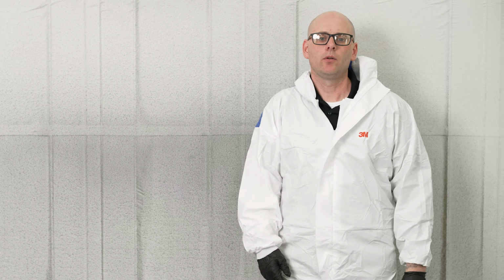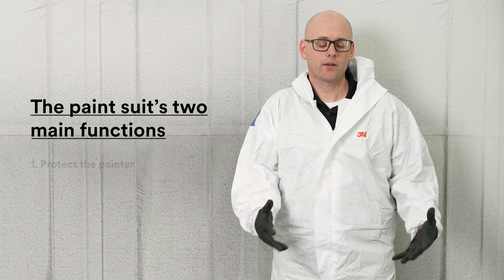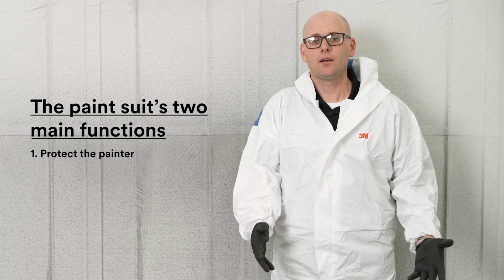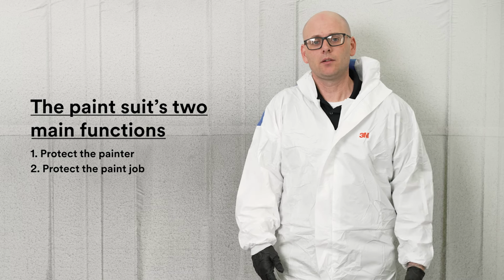The first thing we want to do is make sure we're wearing an appropriate paint suit for painting in. A paint suit has two main functions. The first is to protect us, the painter, from the paint. The second function is to protect the paint from the painter. The body of the painter is a main source of contamination. A lot of things can come off of us from the outside environment and end up in our paint jobs, either causing rework or a lot of time in the sanding and buffing process afterwards.